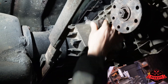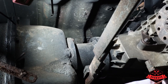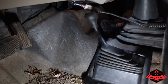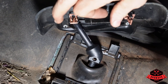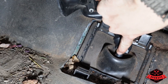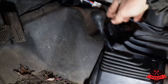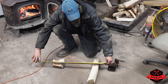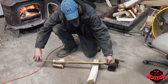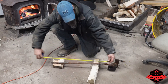Here's our linkage — there's where the linkage hooks on, and we're only about 18 inches too short. We've taken the inside handle and hooked it up to that linkage because that's the one that goes down underneath the truck. This is where the two connect and it's in the two-wheel drive position. We'll take our measurement and get that piece made. We need to be 25 and a quarter inches from this pivot point to this pivot point.